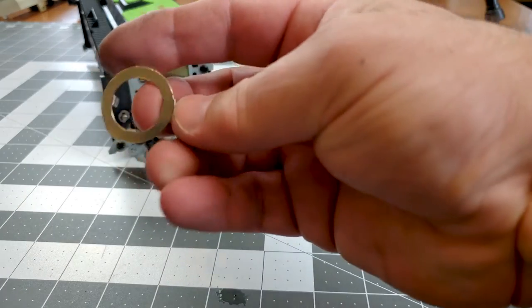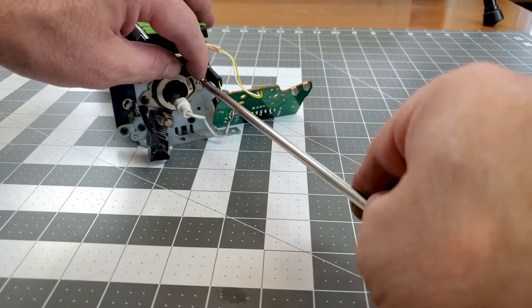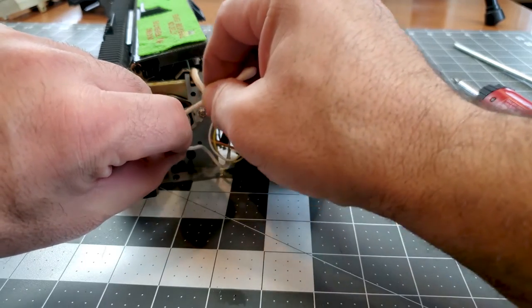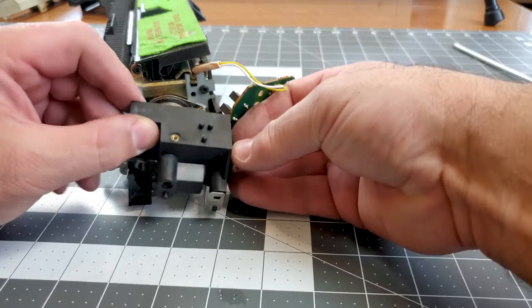It will smell like you wouldn't believe. I also need to make sure there's no oil or contamination on the halogen lamp — if I touched it or got grease on it, it will eventually burn out from the resulting hot spot. Just to be sure, I'll clean it with a swab and some alcohol.